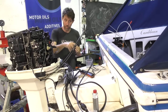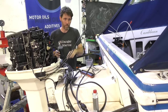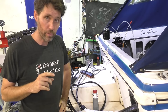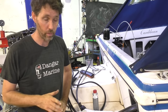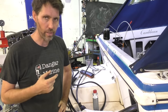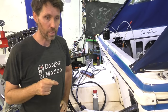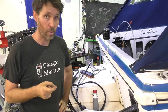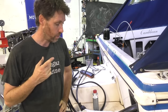I think that last bit of water we had was the water left in the fuel line, because letting it gravity feed the tank got all of the water out from the fuel filter. There was obviously a bit left in the primer bulb and about three metres of fuel line, but I think we're getting pretty close to good fuel. While that settles, I'm going to have a look in the manual for the procedure for priming the VRO pump, because I know last time when I first saw this motor, all the carburetor bowls were just full of oil. I want to find out how to prime it without pushing pure oil into the carburetor bowls. I'm not so worried about the priming really because we're already putting pre-mix in there, but I do presume it needs to be primed to the point where it can actually pick up the oil.